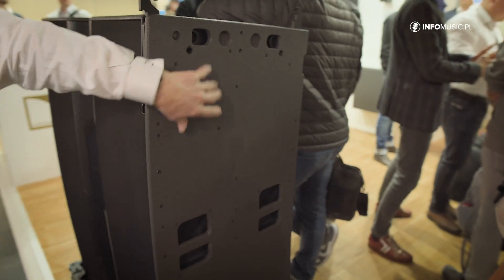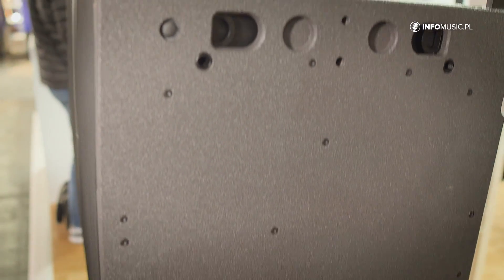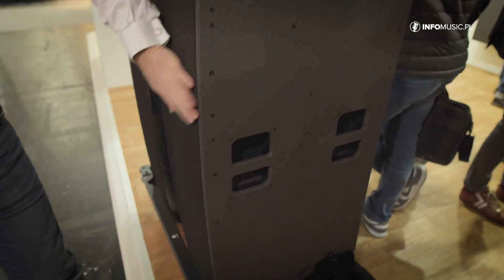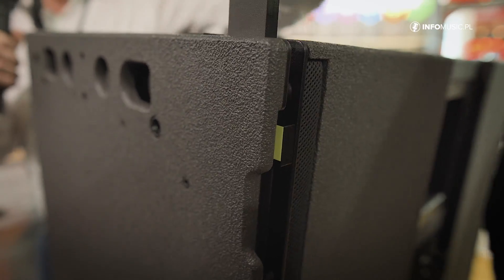What I haven't mentioned yet is what we have on the side that you can't see. Behind here we have two 12-inch drivers — two on each side. The side of the cabinet faces inward slightly, and the 12-inch is facing out to the side, but the exit is at the front. If you go around the back, you can see the exit for the 12-inch back there.